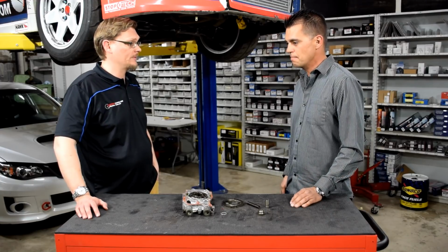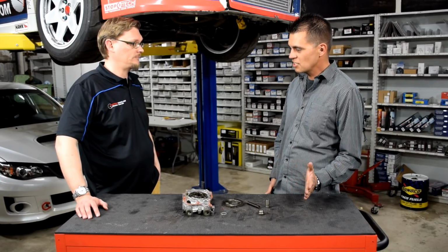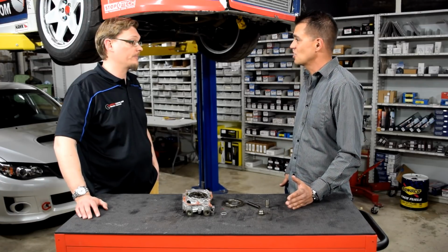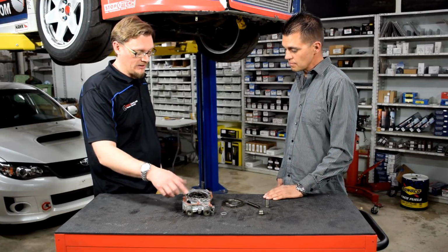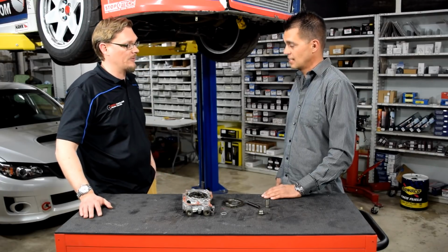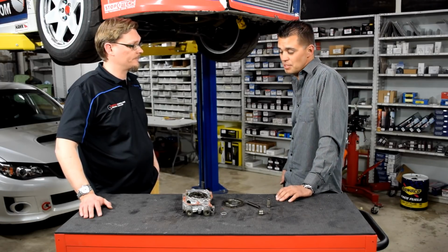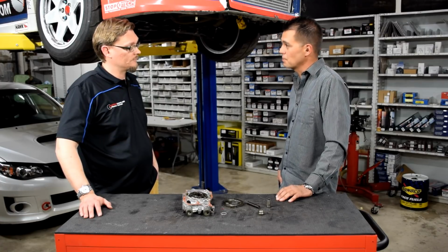So as far as the aspect of whether I'm actually supplying an adequate volume of oil to the engine, if I had too low a pressure, I would expect to see heat, translated into temperatures rising. Or if you had the pressure relief valve open all the time, you'd expect to see a spike in temperature because the oil is just cycling around the pump. Exactly. So, for general comfort, I figured, well, let's see what one shim does in the 12 millimeter pump. And the one shim also brought the pressure up some more.